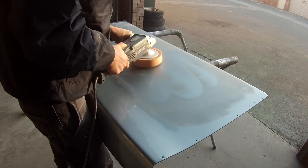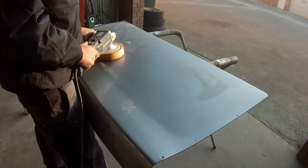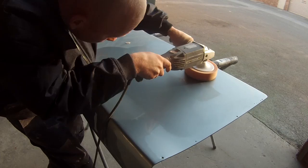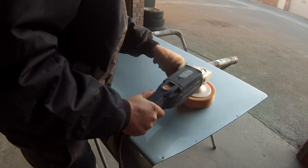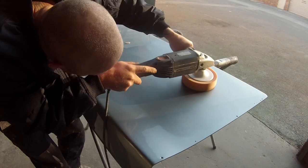The polish I'm using is the Juice Super C — it's a great quality cutter. It does leave a lot of swirl marks in there but it does remove those de-nibbing scratches, so I like to use it. Then it's pretty important that you use the swirl remover after, else you will be left with those deeper swirl marks. The foam pad I'm using for cutting is an orange pad — there are white ones out there as well. The difference between that and the final glaze pad is basically the size of the holes in the foam, and it's just a bit stiffer.